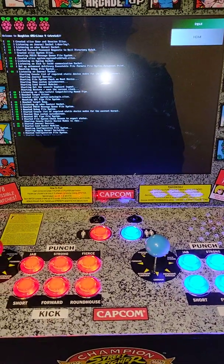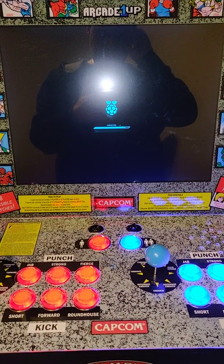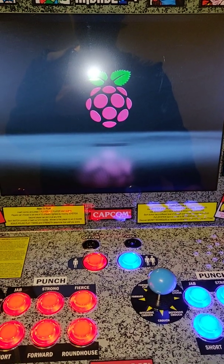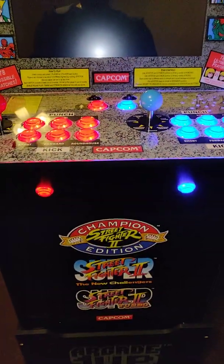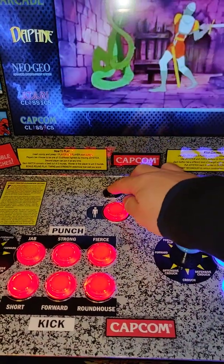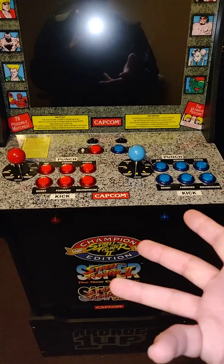We've got the image, which is the WolfanOz 32-gigabyte arcade image — I think that's what everybody is using for this, unless you want to go even more custom. I got different boot-up screens that you can change as your splash screens, and I also formatted them 4x3 with Handbrake, cutting 240 from each side to crop them for this monitor. As soon as it boots up we'll see how it shuts down — all the buttons light up. Everything is working good. I found that to shut down you just hold the button for about a second. And it does — you hear a click and everything is off. That's what I really wanted: not just have the Pi in standby off, but actually completely off.